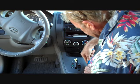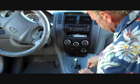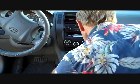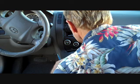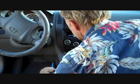With our pry bar, we're going to go in to the edge of this center piece and try to get the pry bar in to pry this panel up around the gear shift, working around the right side and the left side. That will allow us to pull this panel back and over the gear shift. There's a connector here that attaches this panel, but we're just going to let it sit to the side.